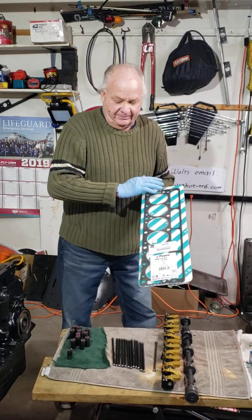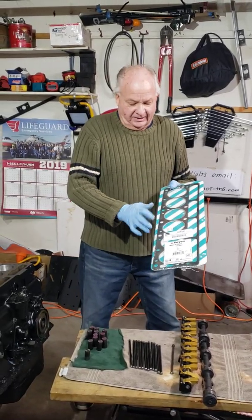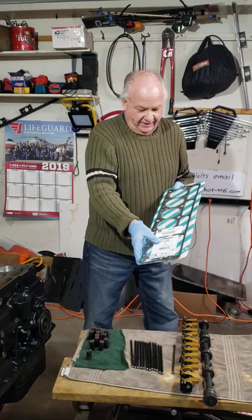This is the early head gasket. It's a late model block, but since I've decked it, it acts like an early model block — so you need to make sure you get the right head gasket.